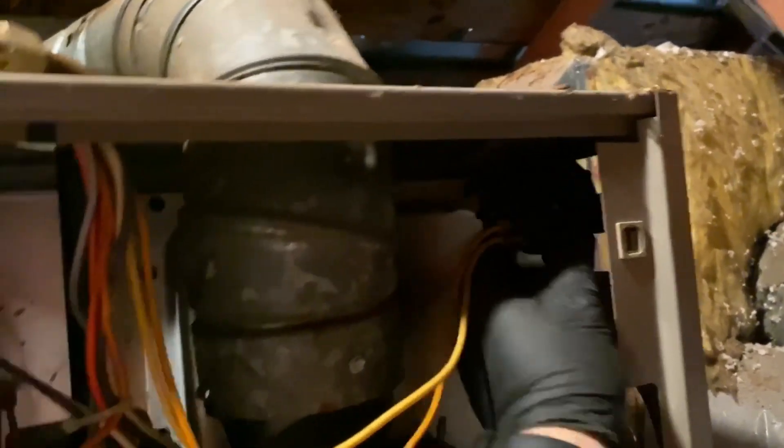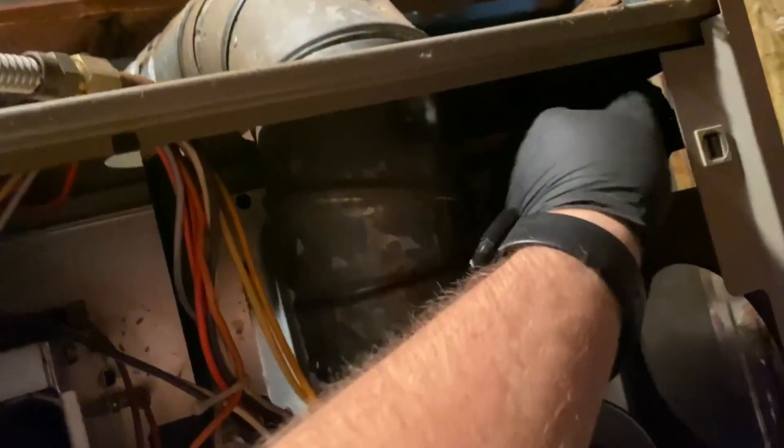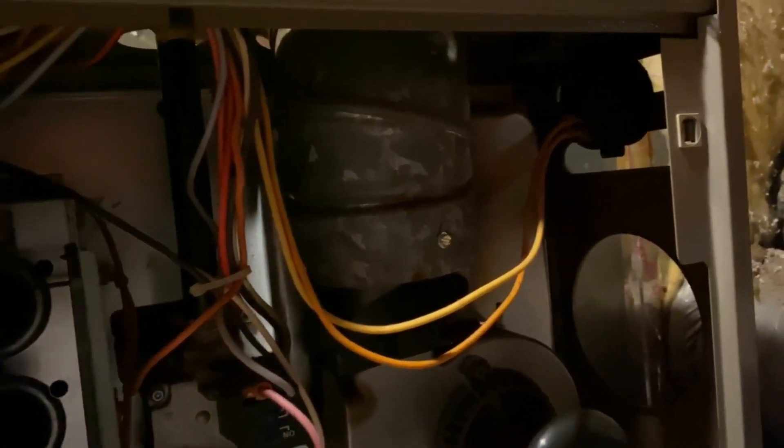This hose is probably a bit long. Next thing we're going to do is clean out the little port in there — I usually use my little tool here. Sometimes stuff can get caught up in there, and same thing with the pressure switch itself. We're going to put this back together and try it again.